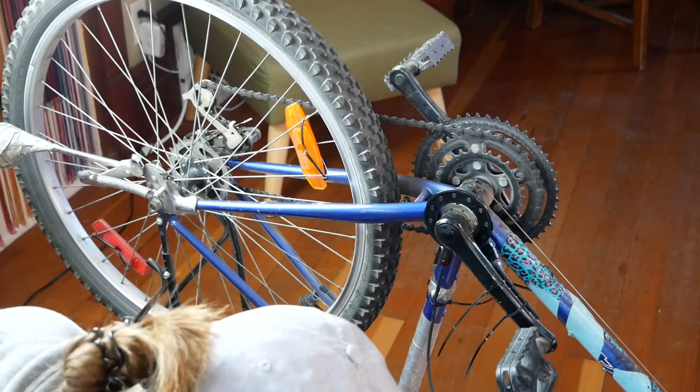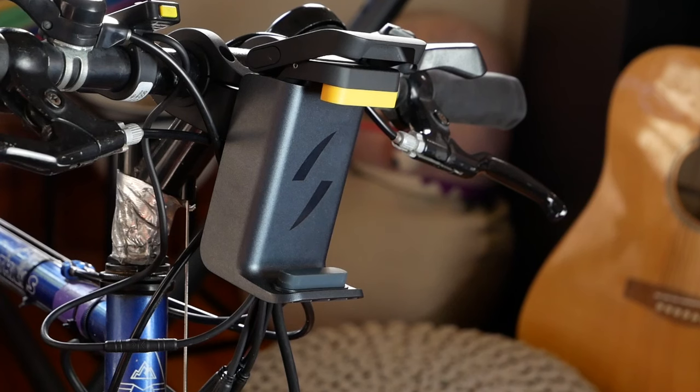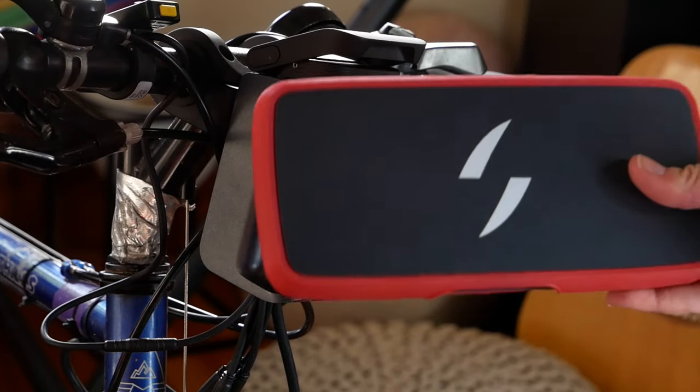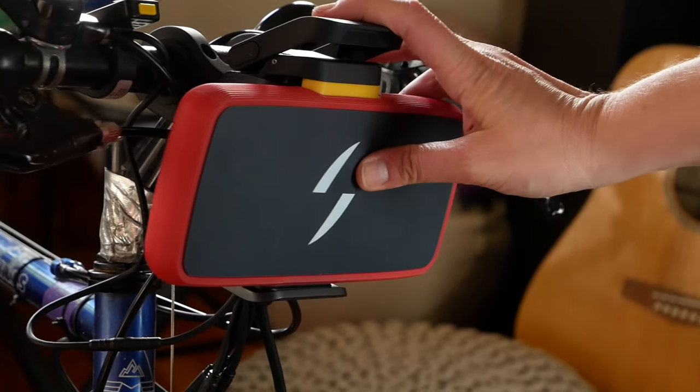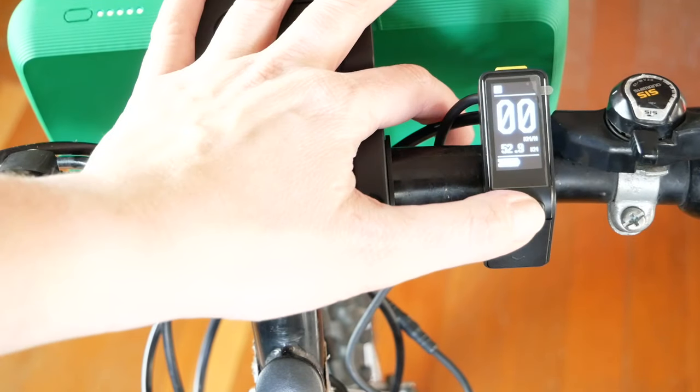Next I installed the power pack mount on the handlebar and plugged in the color-coded cables from the motor wheel and pedal sensor. To install the OLED display, I picked a spot close to my dominant hand on the handlebar because the display also controls the motor wheel's power levels — and you'll want to do the same for a throttle if you choose that instead of the OLED. The installation was easy but I had to find a larger machine screw as my handlebar is apparently wider than average, so the clamp didn't quite fit. When everything was installed, I plugged the display cable into the mount. To add a power pack, you open the mount, insert the power pack bottom first with the power connectors facing up, then close the clasp and make sure the connectors slot in correctly at the top. When you're done, you can test your installation and arrange for a final installation check-in with the Switch team, who will visually check your bike on a video call and answer any questions.